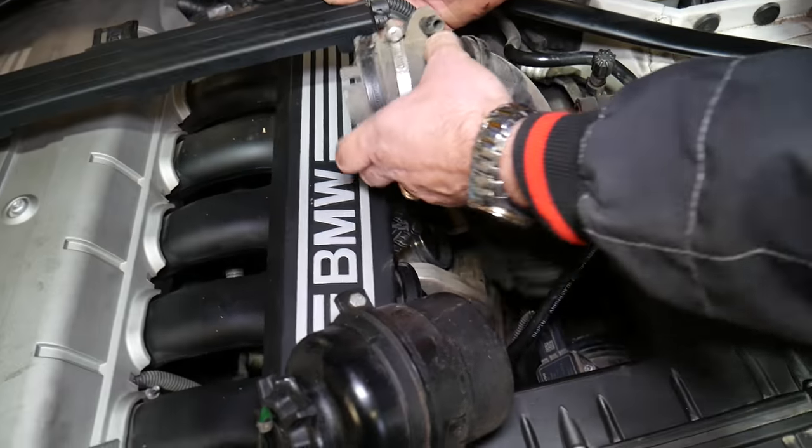Now the purge valve is located right here — squish right here and pull it out. You need to slide that mount with cables out; there are two teeth you need to jump. I pried it with a screwdriver on each side and pulled the plastic up. The purge valve has one more hose pre-disconnected on the bottom — same design as the top one. There is one wire on the back side: press the metal piece and pull out.